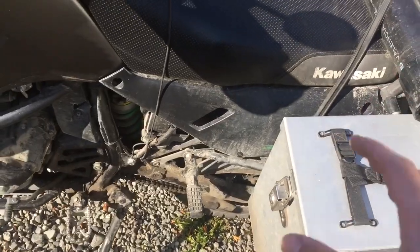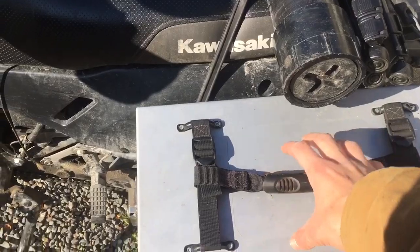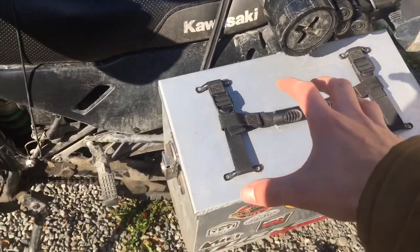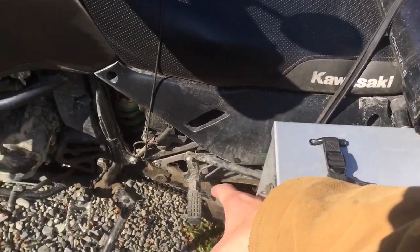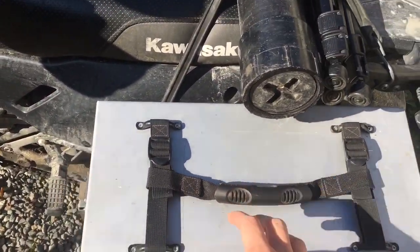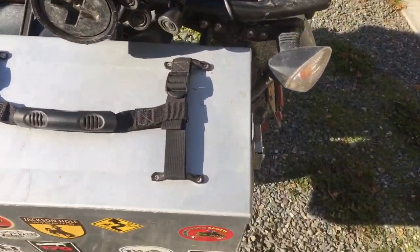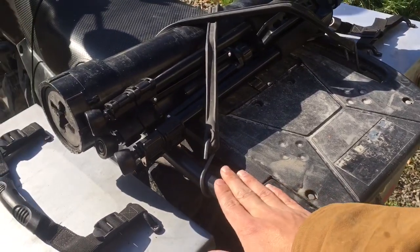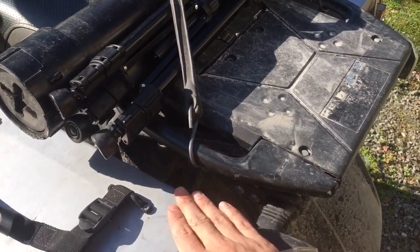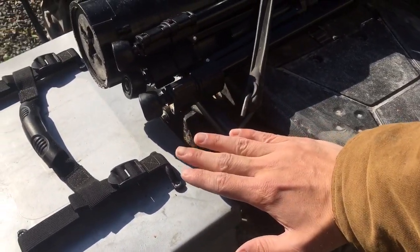Being able to still carry a passenger was very important to me, so I was careful when mounting the handles. You can mount them in all kinds of configurations — up, down, forward, backward — so I positioned them to leave enough room on the foot peg for a passenger's foot, and I kept them low enough to maintain a low center of gravity. If you have a top case that sticks out past the rear rack, you also need to mount the panniers low enough that the lid can clear the box when removed.